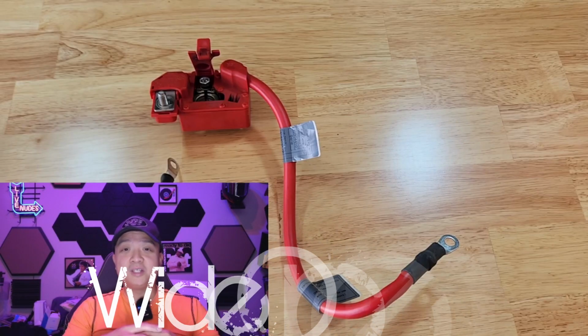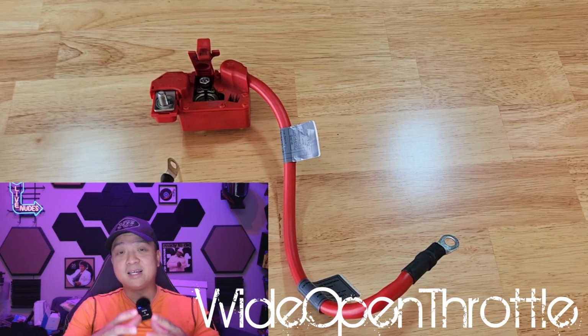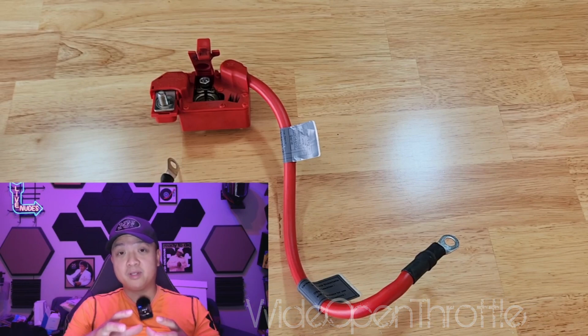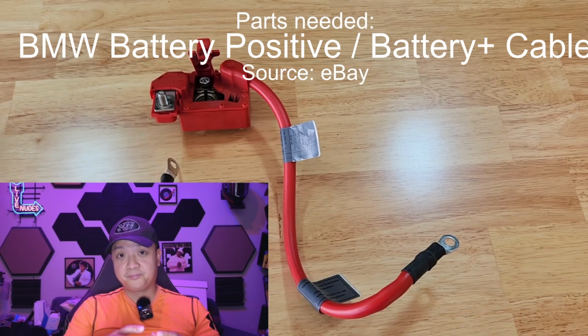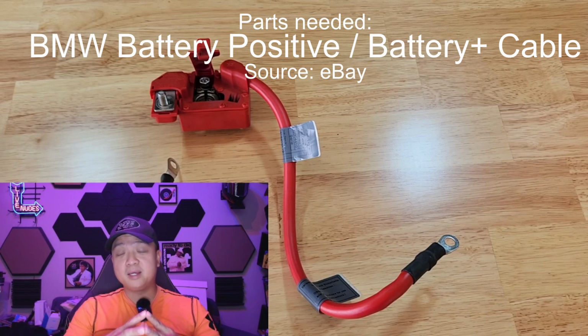Alright guys, so what you see now on your screen is the battery positive cable, and what it does is it connects your battery to the engine bay. So one part of it goes to the battery positive terminal, and the other end of it goes through a wire all the way up to your engine bay that does all of its electrical functions. So why is this important?